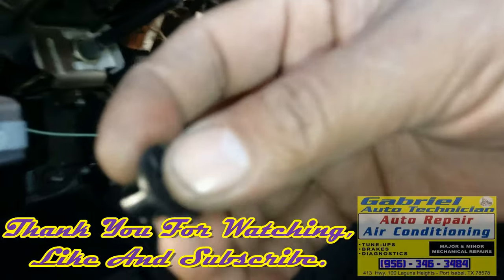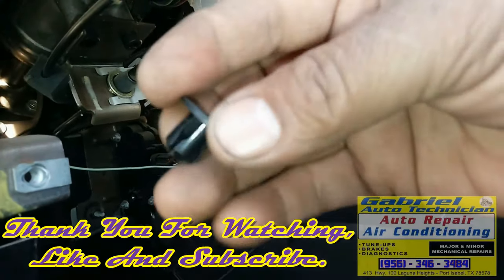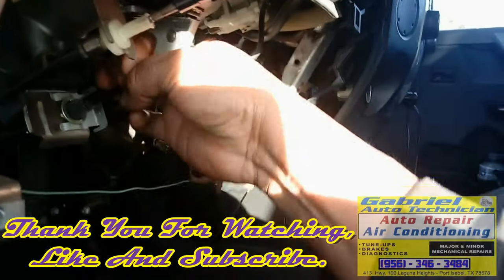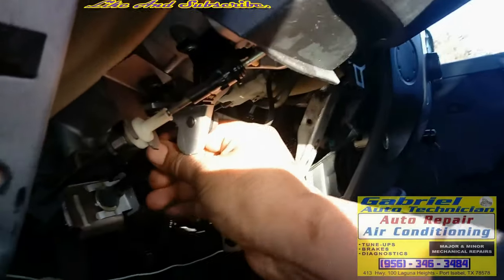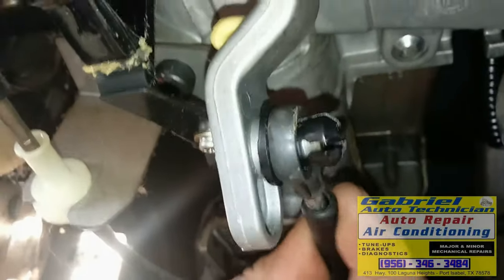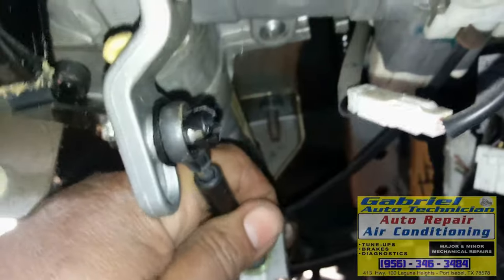Now let's put it in. You need to put it right there into the cable first and then push it, like the other kind of bushing. I push it — it works. It stays right there real hard, because that outside part — those four parts — lock the shifter cable inside. It acts like a lock, so there's no way it comes out. That works — it works better than, or the same as, the right part, than the original bushing.